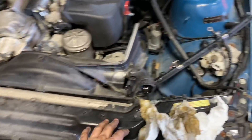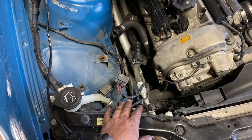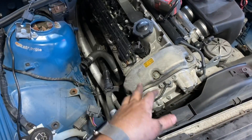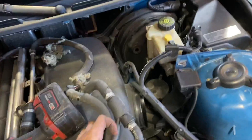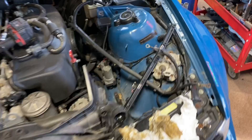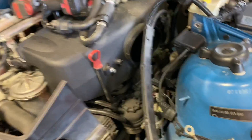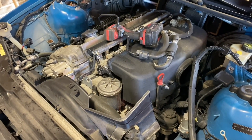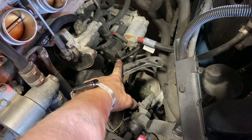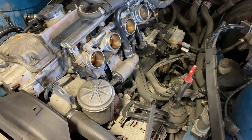First few things topside: airbox, air snorkel, starting to take the shroud off. Clutch fan is loosened. Reservoir, oxygen blower, air pump, coil cover — coil harness undone but I left the O2 harness on. Brake vacuum released and put on top of the engine. Removed the bulkhead covers and the side cover. Getting to the back retaining bolt for the airbox now and removing the dipstick nut. After that we should be able to remove the plenum very carefully, releasing the oil drain on the bottom at the same time. Like pretty much every S54, there's a big vacuum leak and the oil drain is not snapped into the bottom of the plenum. However, it's in otherwise very good condition.